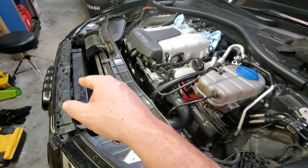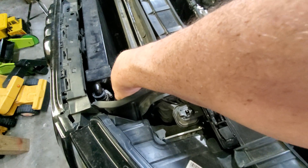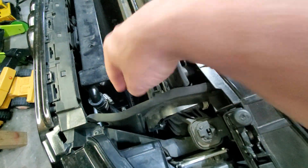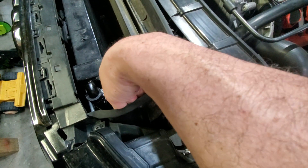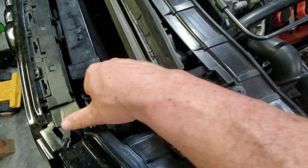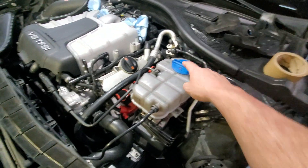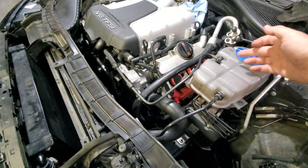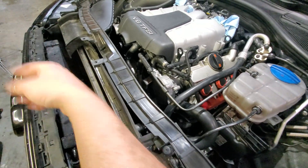What you're going to do is disconnect this hose. Mine has the exit pipe that only comes down a few inches. If you've got one of the newer ones, it goes all the way down to the bottom of the car, which makes this a little more difficult. But if you've got one like mine, undo your clamp here, push it down, and break the seal on your hose — just enough so air can escape from this exit pipe. Keep the reservoir lid on, and once you've broken the seal, open up the lid. That breaks the vacuum on the system and allows the fluid to push down.